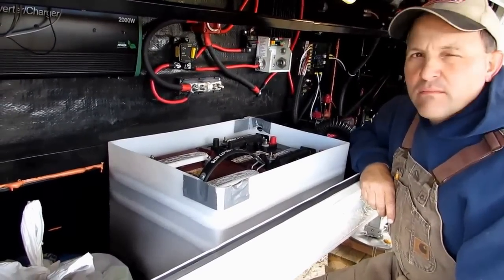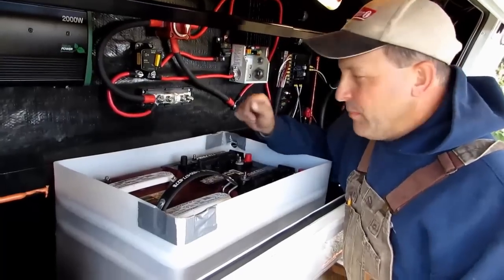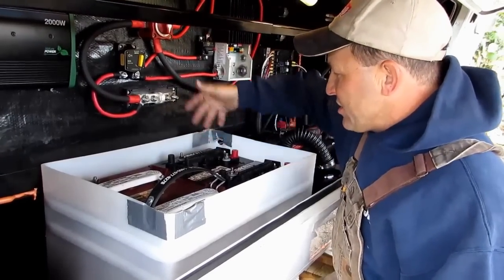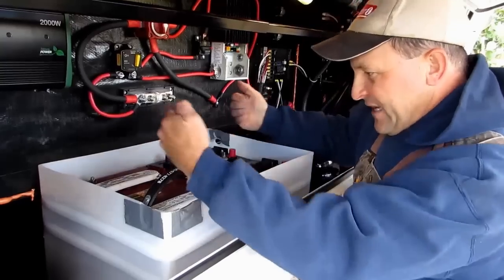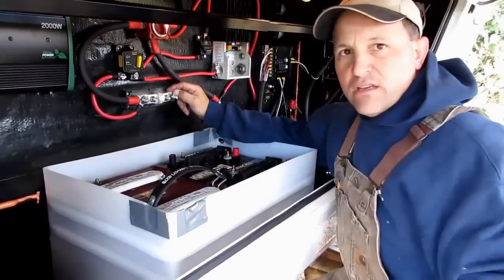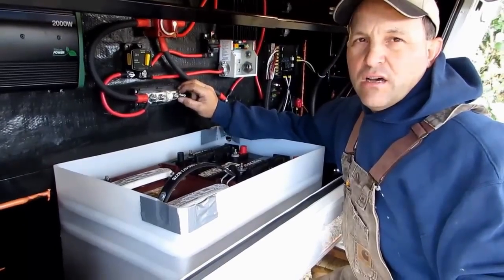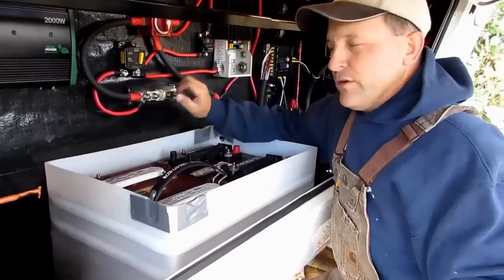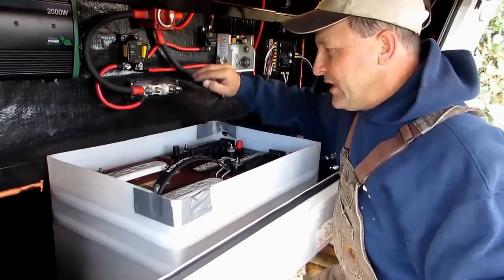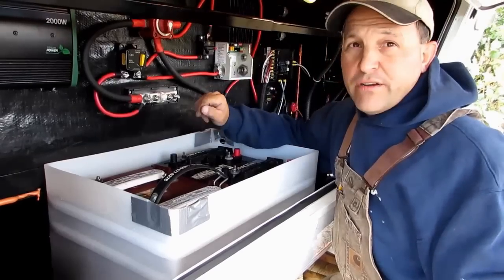When I put the batteries in there, I had them with the names facing us, right? What you get is negative to positive, which is fine, but what we're trying to do is shorten up our lead coming off of your bank on your positive side. To do that, I'm just turning each battery around so that instead of facing this way it'll be facing that way, and come right across here with my positive, then we come right out of here with your negative — so we can shorten the distance on the positive lead.